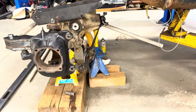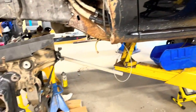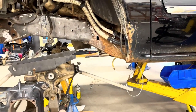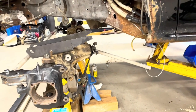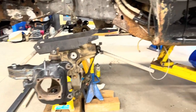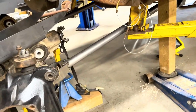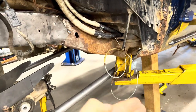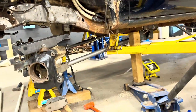Moving up to the front. I think I'm confident enough within about an inch to cut my front radius arms. I'm not 100% sure if I'm going to make it go to the top and then tie the bottom, or vice versa. But I'll get them cut and then I can weld the clevises on the end, and might have to trim off a bit at the back depending where I end up with the axle, but it'll be close enough. I've got the radius arm hooked up to the bottom.